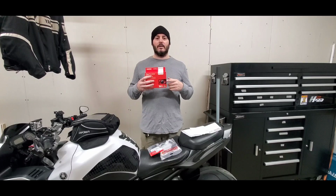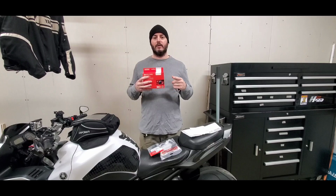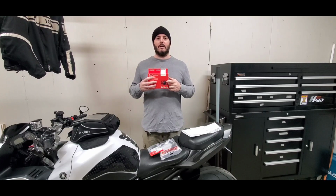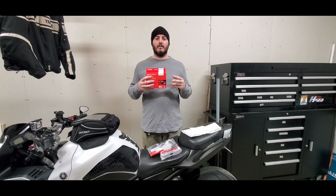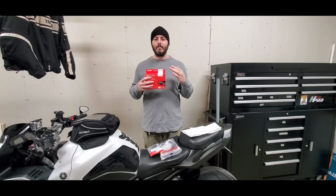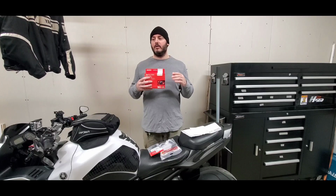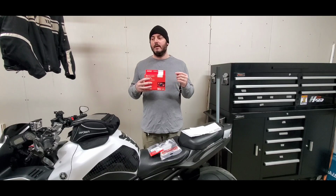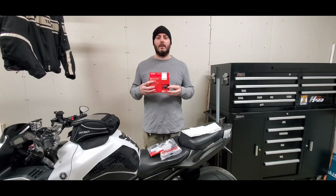Mine's mainly if I'm hauling a trailer that's got equipment around town, and I wanted to be able to have a brake controller for it. Another upgrade that you're gonna wanna do on a Tacoma specifically, if you're adding a lot of weight in hauling, is upgrading your front rotors. Even if you add the brake controller, if you're hauling all the time, I think it would be better to go ahead and add a brand like Power Stop, which has tons of reviews and gets used all the time. You're going to want to upgrade the caliper, the rotor, and the pads for the Tacoma to Power Stop.